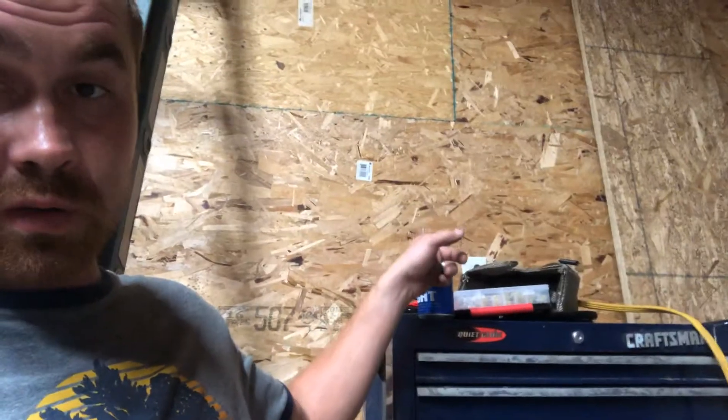That's all I got. I got to unload the camper tomorrow and clean it out because we were camping in a sandy area and I've got quite a bit of sand — the kids were in and out all the time. Hopefully I'm going to go to work sometime this week; it's already Tuesday or Wednesday morning. Thanks for watching guys. I will make a video about those headlights if anybody is interested. If you own a semi, buy yourself a turbo blanket and wrap your turbo — it's a T6 housing, so research T6 turbo blanket. There are a lot of T4 versions which are pickup truck size turbo housings — that one will not work, you have to get a T6. Amazon has a whole bunch of them. Anyways, have a blessed one, thanks for watching.